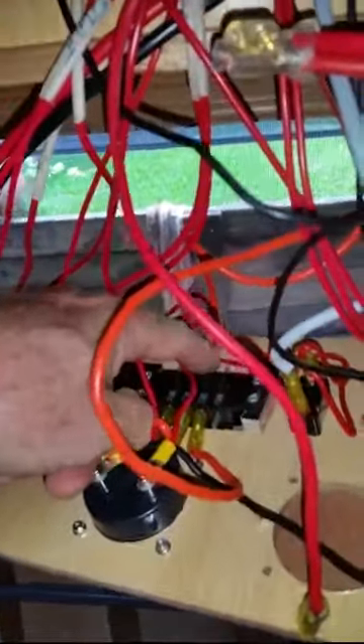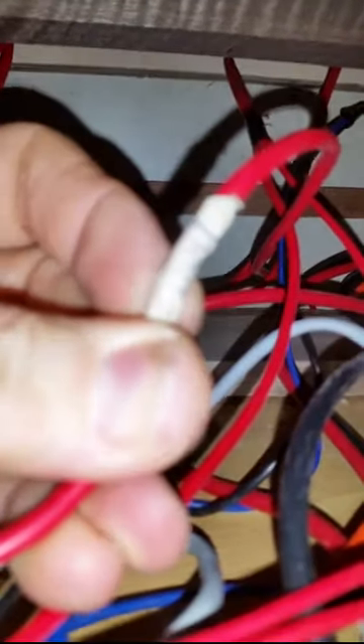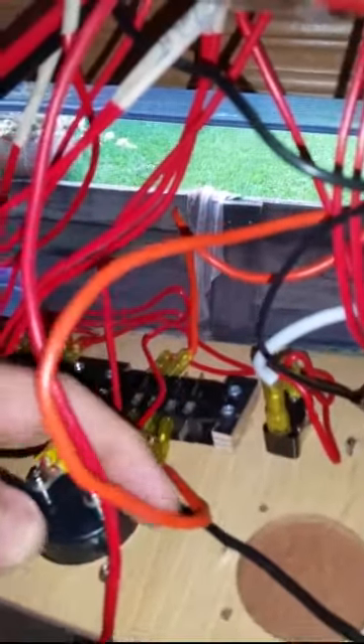This wire here was connected to the fridge fuse, but there's no 12 volts on it. I don't know where it goes because there's no wiring diagram - it disappears down the wall which has sealant in it. It's got some cryptic label like 'front' or something and I have no idea where it goes. This was supposedly supplying 12 volts through the fuse holder and onto the orange wire which goes back down the wall and appears at the fridge.